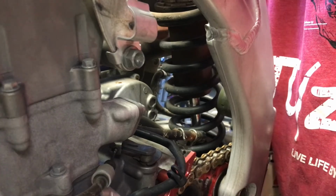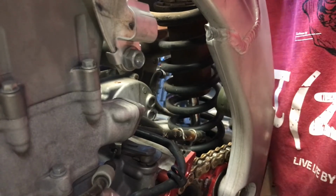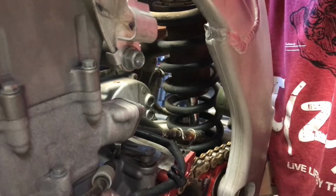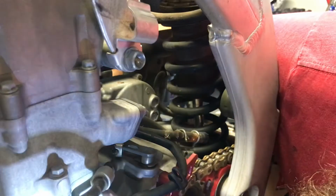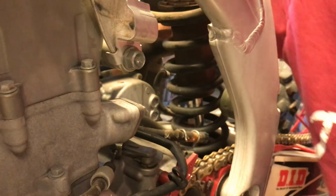If it comes to a stop and touches the valves, then you might have a bent valve if your timing is correct, or you're just one tooth off or something like that. Oh my goodness, come on. Just rotating it a few times. Feels good. Feels good. Make sure we're still timed correctly. One more time. All right, we're timed correctly up there. And timed correctly down here.